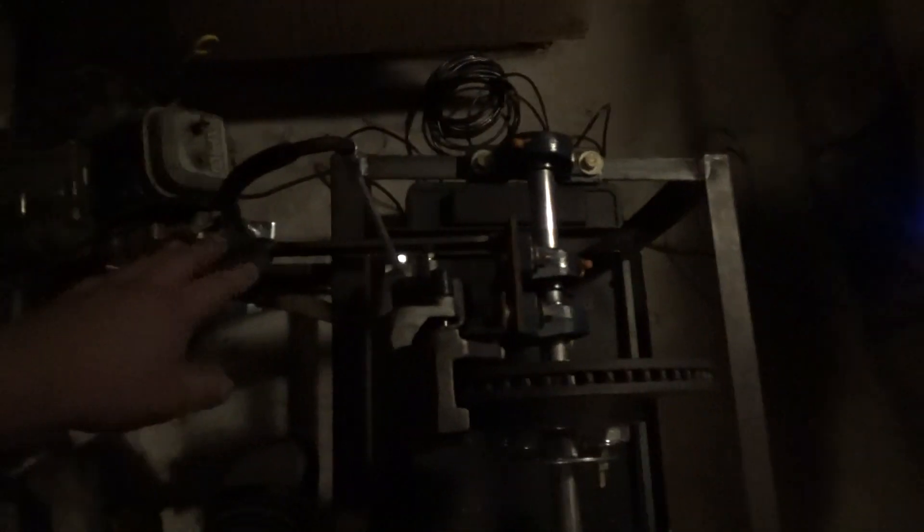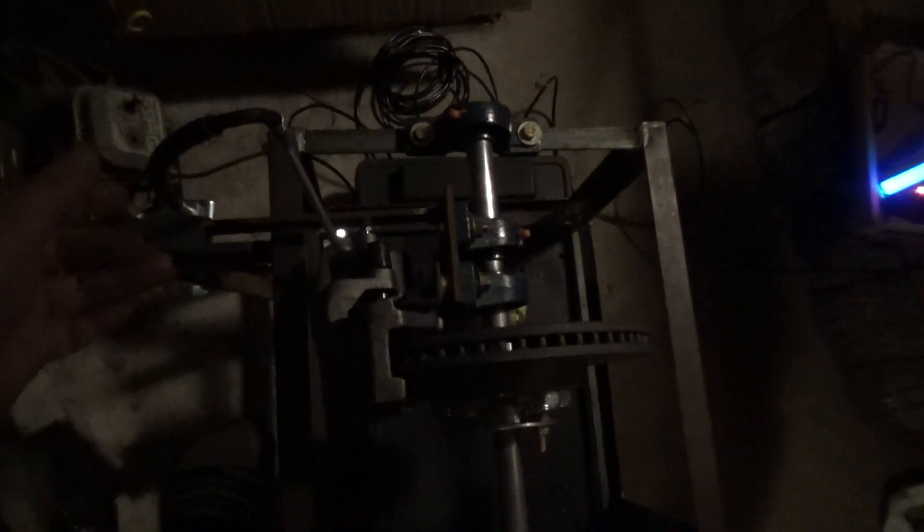What I'm going to do is go over here to this load cell. You can actually pick the thing up and see the reading. I'm going to show you that because the engine on this thing rotates clockwise — it's going to be picking this caliper up whenever the brakes are applied, and with that it's going to be transferring the force through this rod on this load cell, and that force is readable on my screen. I'm going to pull up on this as if the brakes were being applied and the motor was running.